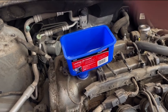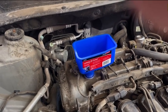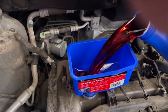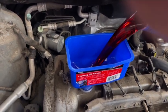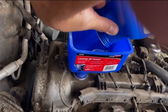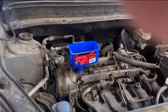Round two. The engine flush and one quart of ATF with the very dirty oil has been run through and flushed. This is round two — we're going to be doing the full three and a half quarts of ATF. For those who don't know, ATF is thinner than motor oil, which is why we're not going to drive the car. But it's filled with tons of detergents, giving you an insane cleaning ability in a short amount of time, as long as you don't run the engine hard or put it under load.